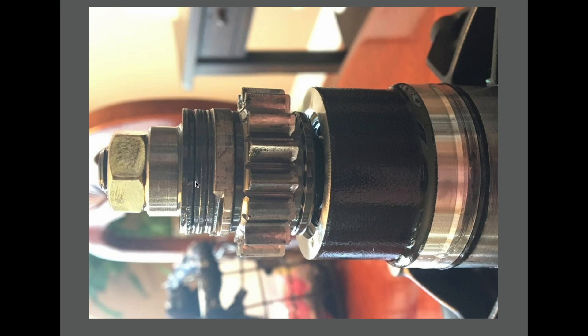You do not want a straight mechanical connection of the supercharger to the engine, because with all the rapid RPM changes and hard acceleration and deceleration, the forces on the shaft with the supercharger spinning at 50,000 RPM will just completely shatter it. You need something to dampen those forces, and that's where these friction washers come into play. When we set the slip moment, we are telling the supercharger when it should begin to slip. We don't want it too high because the clutch washers will need more force to slip, putting more stress on the shaft. But if it's set too low, you won't build maximum boost and you can overheat and burn out the washers faster. That's why you want to get it closer to the upper end of the threshold - to hit peak boost without stressing the washers. Eventually these washers will wear out and you'll suffer performance loss, which is where slip adjustment comes into play.